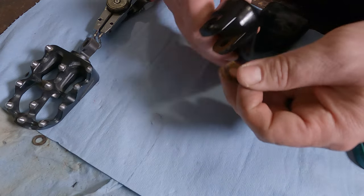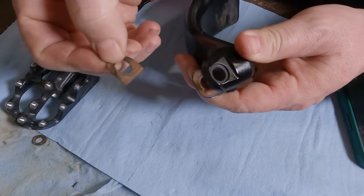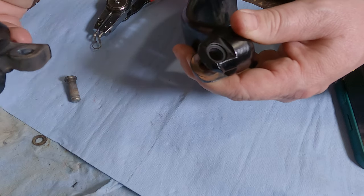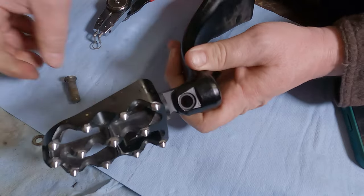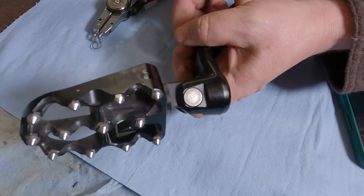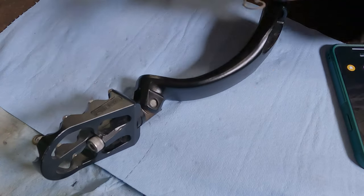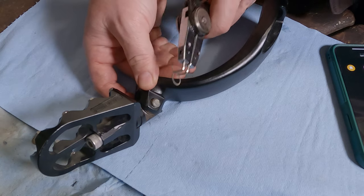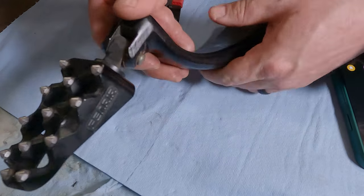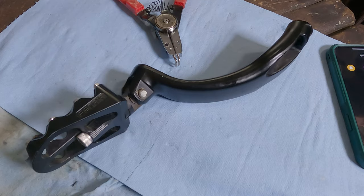To reinstall your new foot peg, I would recommend sliding the washer in there first — it goes in squared off end first. Slide it right up in there. Then take your new foot peg and slide that in place. You should be able to look down inside there and see everything's lined up. Then take your pin, slide it back in there, turn it over, and reinstall your snap ring. Squeeze out the snap ring pliers, drop the snap ring on there, and give it a visual inspection to make sure it's down inside that groove. Everything looks all well and good, and now you're ready to reinstall the mount back on the bike.